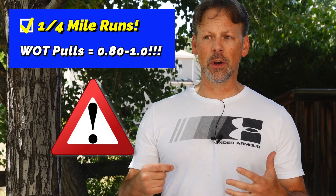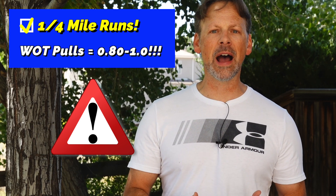Even more concerning was scenario number four — taking it to the track. I was super excited going to Bandimere Speedway. After the very first pull, and I ran four or five pulls, it kept going up drastically. According to the data logs, the car looked fine until about 80 miles per hour. After 80 mph on the quarter mile, it went crazy — it really did not like that higher speed. I experienced K control values of just under one: 0.8s, low to mid 0.9s. That scared me. I called it quits — I don't want to damage the engine.